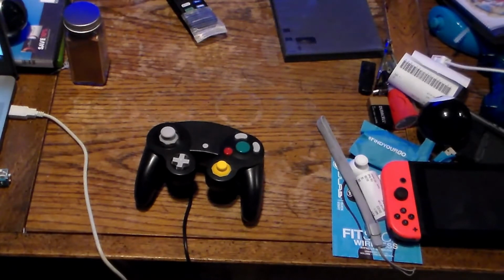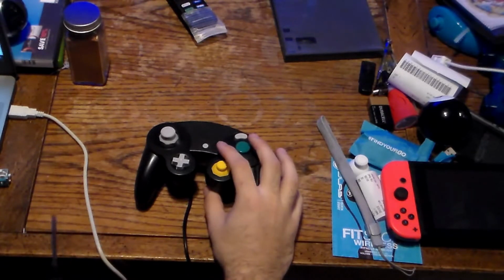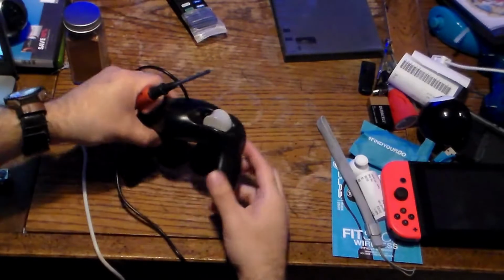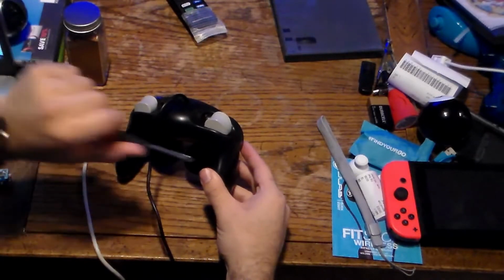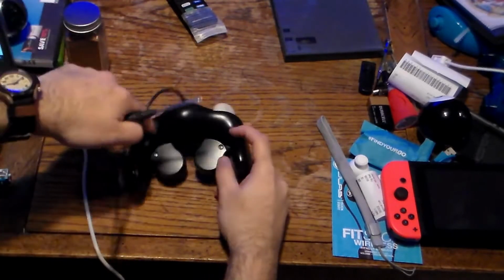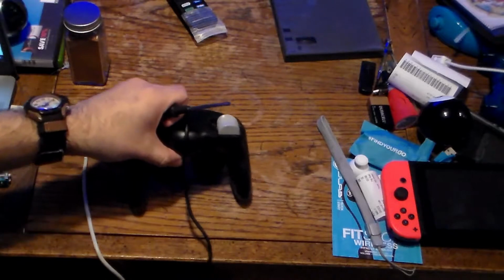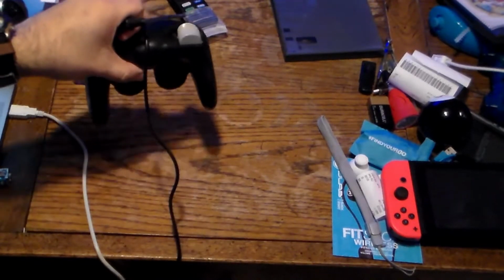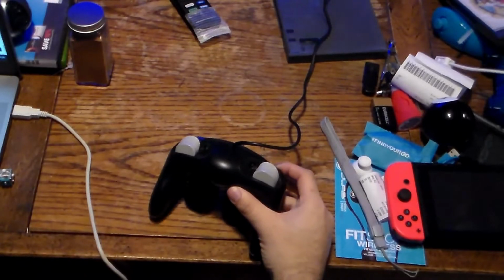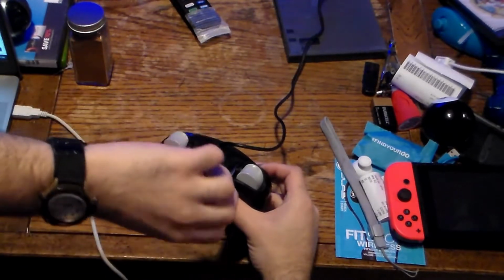So, like most generic GameCube controllers, they use a Phillips screwdriver, not a tri-wing like Nintendo. What you want to do is flip to the back side, and you are presented with these 6 screws right there. If you have the TTX Tech one, there would be a sticker right here, or at the top. Since this is Cirka, no sticker is included, which is good because I honestly hate when they put a QC Pass sticker on it. So let's go ahead and open this controller.